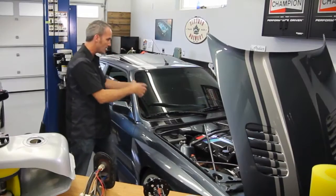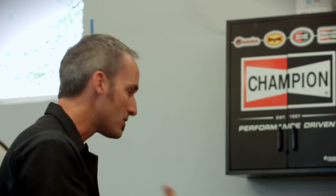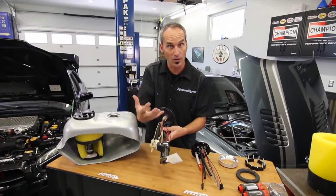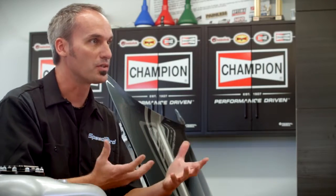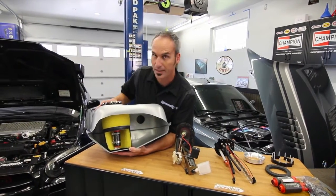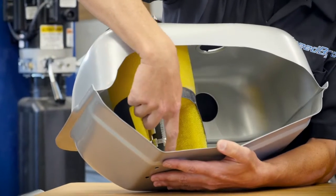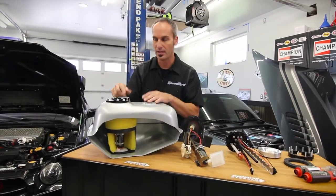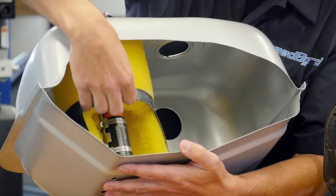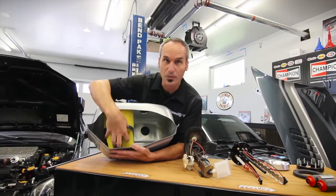How are you going to feed this beast? The original 190-some horsepower engine doesn't have a system set up to even adapt. So if I don't have a frame where I can easily go in and change out the pump and get all the flow that I need, I need a system to start with to make it easy. That's where the Phantom system comes in from Aeromotive. If you look at it, it's exactly everything we had to work with on our WRX — a frame holding the pump, sock filter, an upstage top system with our inlets, outlets, vents, and everything we need. Plus, it even has foam and a reservoir baffling system that really helps hold the fuel where it needs to be.